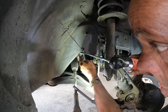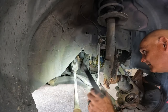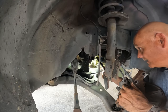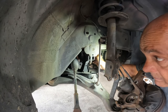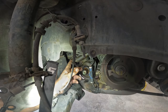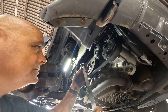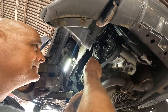To get that cover off I think it's an 8 millimeter — and that's what it is. Looking at my schematic it said there was another 8 millimeter on the back side, but this looks more like a push clip to me. I'll reach around back here — yeah, I believe that's just a push clip. So what I'll do is snap it off with a pair of dikes and go back with a new clip.